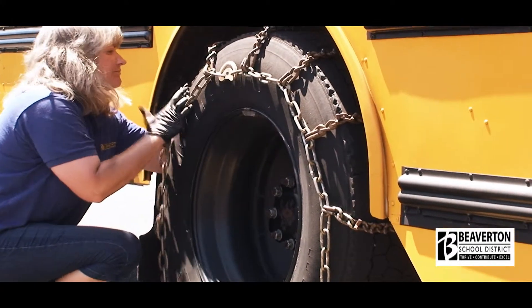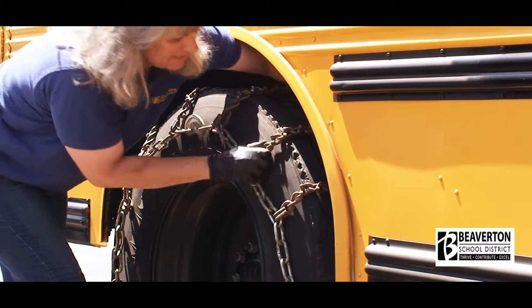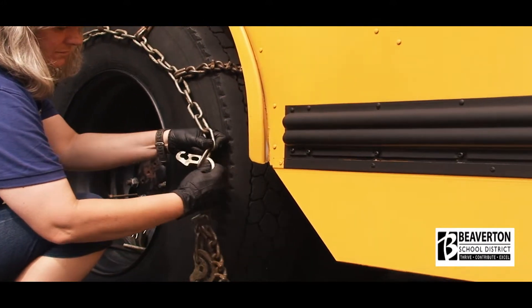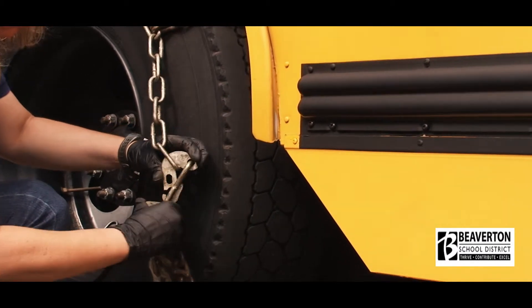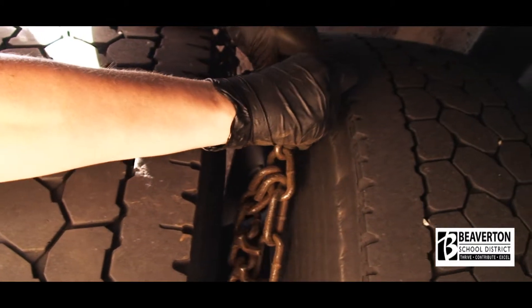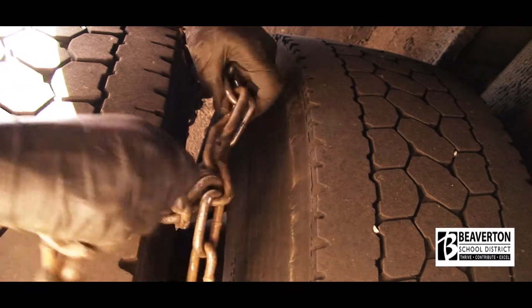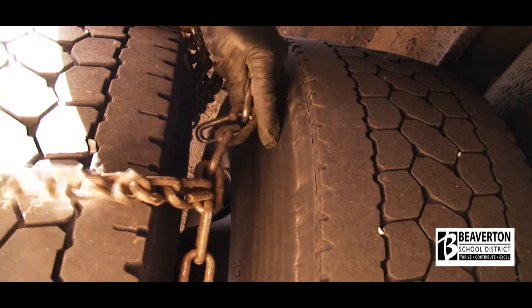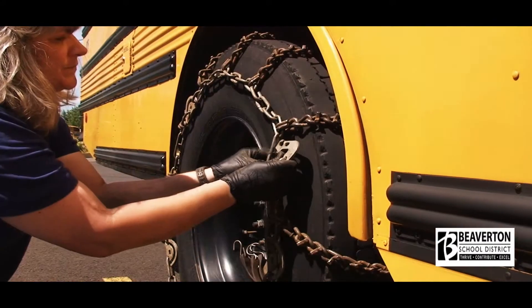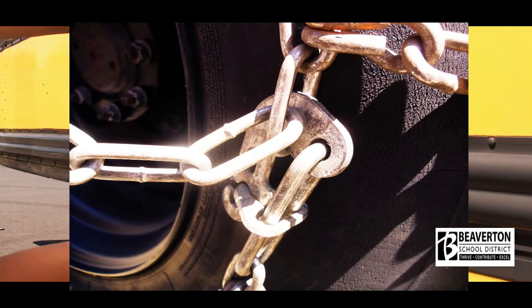At the back edge of each tire, start at the ground and work the chain up and over towards the front of the tire to get out as much slack as possible. Hook the outside chain link first before the inside to avoid the chain being knocked over the tire onto the axle. Then re-lock the outside link after you've finished the inside. At the front of the tire, hook the chain on the inside as tight as you can get it. If more than two loose links are left hanging, make sure you wire them up so they don't cause body damage by hitting the undercarriage, taking off paint, or hitting against the tire. Hook the outside of the chain as tight as possible and make sure the extra links are hooked away from the tire so they can't rub.